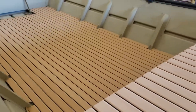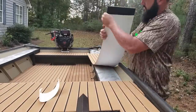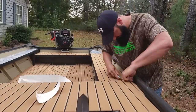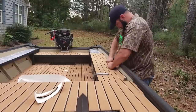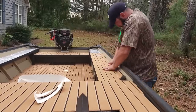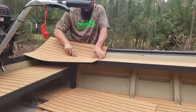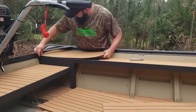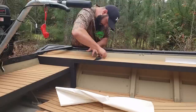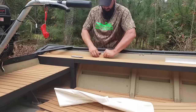Everything you just saw was prior to installing the catwalks in my boat. After the catwalks were installed, they needed to be turfed as well — same process: clean everything well, sand with 80 grit, clean again, and stick the turf down. I bought a total of six sheets of Hydro Deck for my boat and used all six, though I did have some larger pieces left over for things like a cooler lid or future repairs. Six sheets covered my 1648 completely decked out with two catwalks — the front deck was a little over seven feet long and the flooring section was about nine feet long.